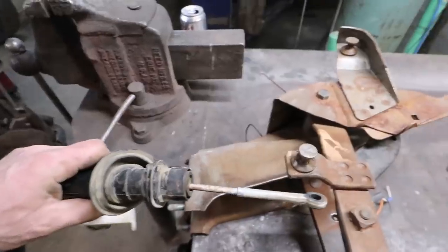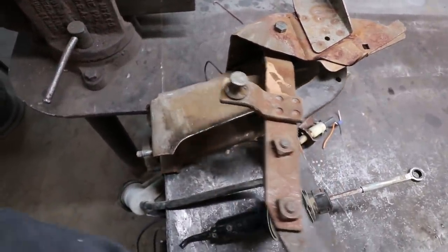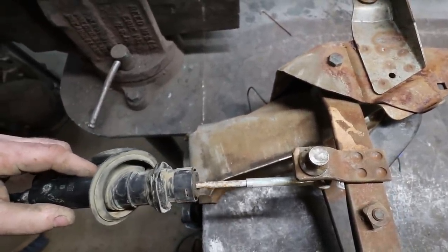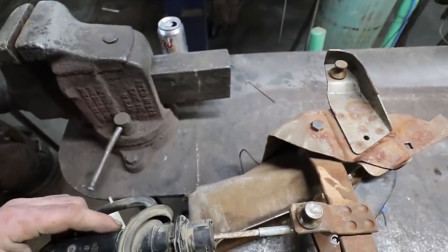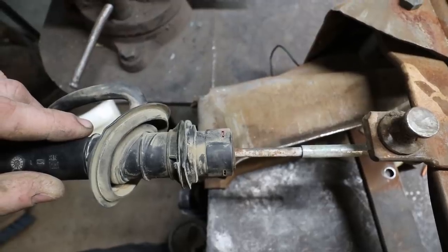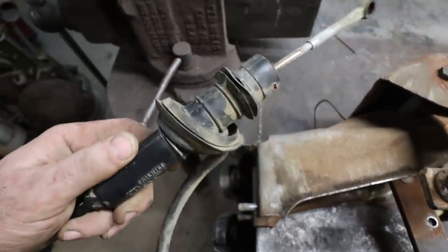So I've been daddling, and the swing is not crazy. Like when it swings, well, how far do you got to go, right? But when you put the stock Dodge master on it, it kind of fits around where the spring was, and then the transition is not crazy. You're not putting any weird side load. It should be going dead nuts straight in and out. There's a little bit of a transition, but nothing crazy. I don't think it'll bugger up the master.